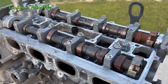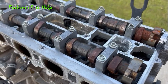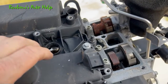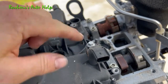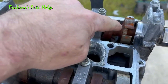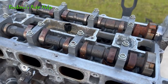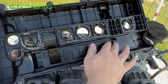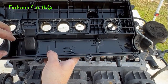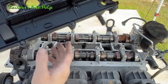Look at all that water. So let's talk about the valve cover — it serves a few purposes. One is to cover up your valve train. Whenever the engine's running both your camshafts are spinning, there's lubricant everywhere getting slung all over the place, so it covers the valve train and keeps the oil inside the engine. Also on this valve cover you have mounting holes for the camshaft position sensors, which pick up on the trigger wheels on the back of the camshafts and let the PCM know what position those camshafts are in during their rotation. Also the valve cover is part of the positive crankcase ventilation system — this little inlet tube right here is a fresh air inlet for the PCV system. Fresh air is introduced into the engine, circulated through, and goes back out through the oil separator through the PCV valve and then into the intake manifold.